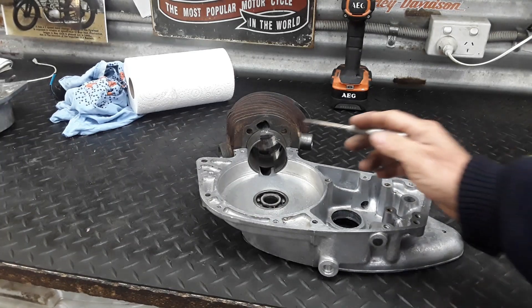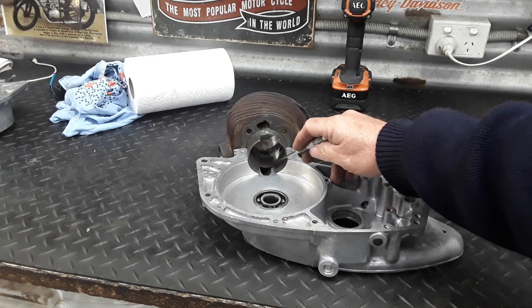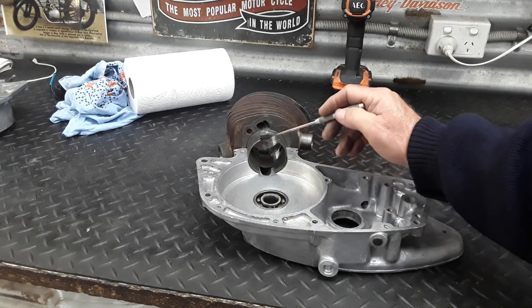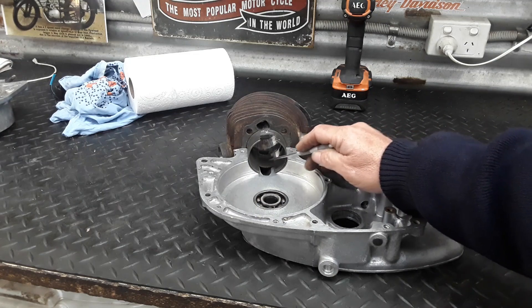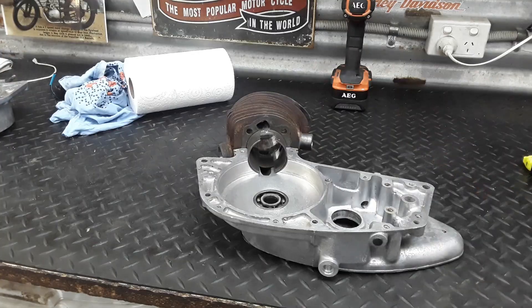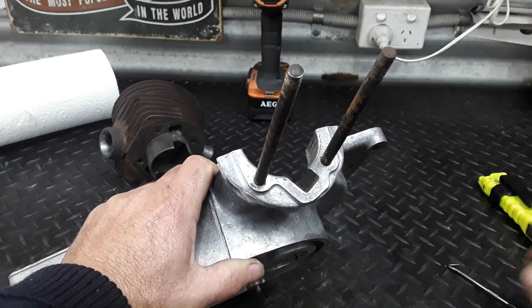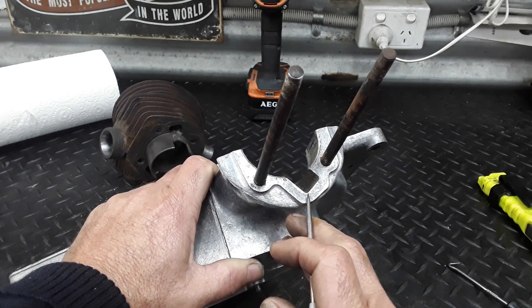We've dropped the barrel on and we're looking for a lip between the case and the barrel — and we have got a lip on this side where the case is actually overhanging the barrel. So we're going to have to take a little bit out of the side of this case. This is not a full blown race porting job — all we've done is clean up all the ports, make sure there's no casting dags, make sure the ports are in the right position, and make sure there's no overlaps to interrupt the flow through your transfers. We'll take this apart and I'll just take a lick out of this side. I've got this bent scriber so I can reach up into it — you can see how much it's got to come out just around here.